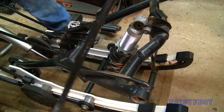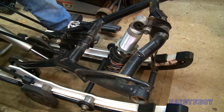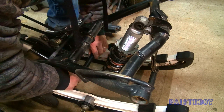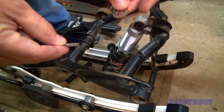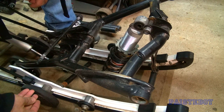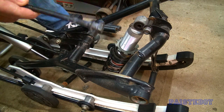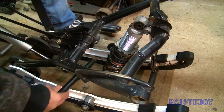Here's that shaft with the 16 millimeter head - we'll set that right there for now. We have to take this assembly out of the center along with the two washers that were on the inside of the rails. We'll put these on the inside because that's where they go, and the other outside one is still on the shaft.